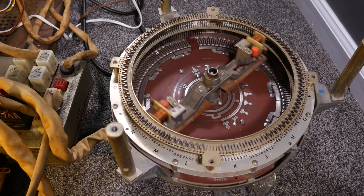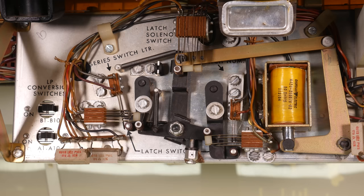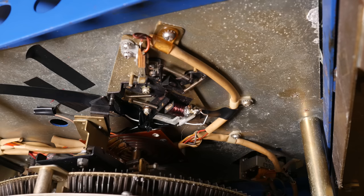As it rotates around, the electromagnets are sweeping behind all those pins, and when it gets behind the pin for the selection we've made, it bridges that circuit created by the buttons, fires, attracts the pin towards itself, and the pin pops up. Then, right when the selection accumulator is back to its home position, it pulses a relay inside the jukebox, which will release the latch solenoid, so pop the buttons back out. And fire the reset magnet and turn on the record changer.